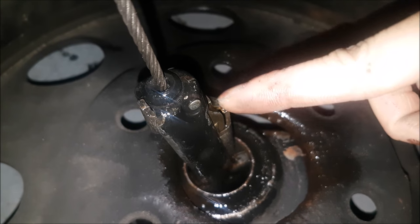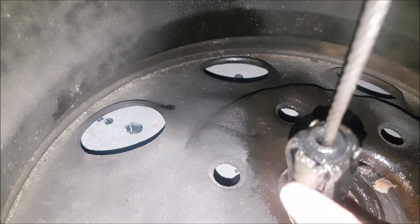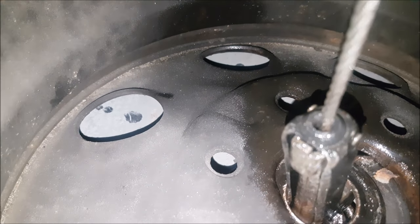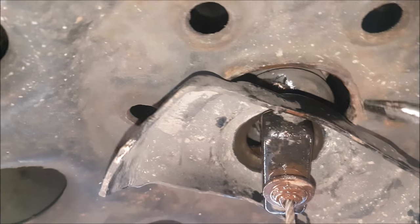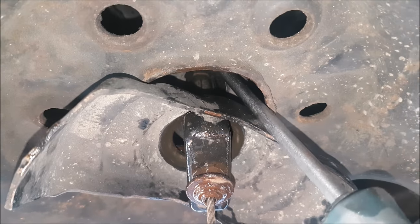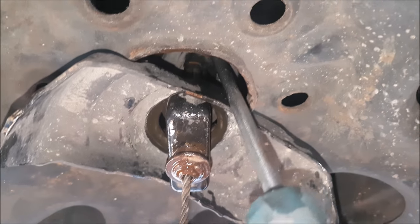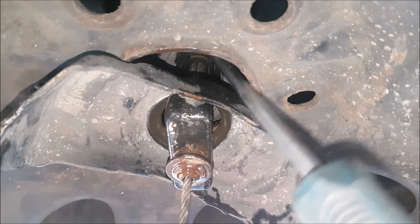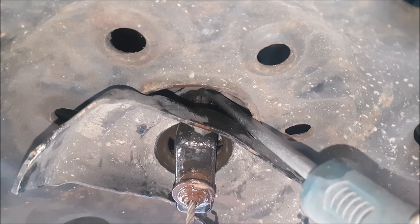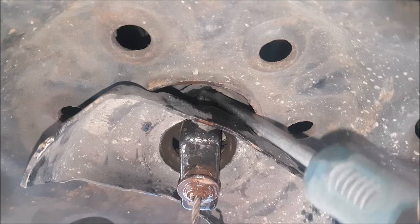This is it when it's pushed in. What you have to do is put your screwdriver all the way up through here and push on it — that will release it. Because we have a bigger diameter tire, it gets caught in the safety latch. If you're running bigger tires and have a trailer hitch, it's affecting the angle. You can see the boot there — you get the screwdriver onto it to move it.